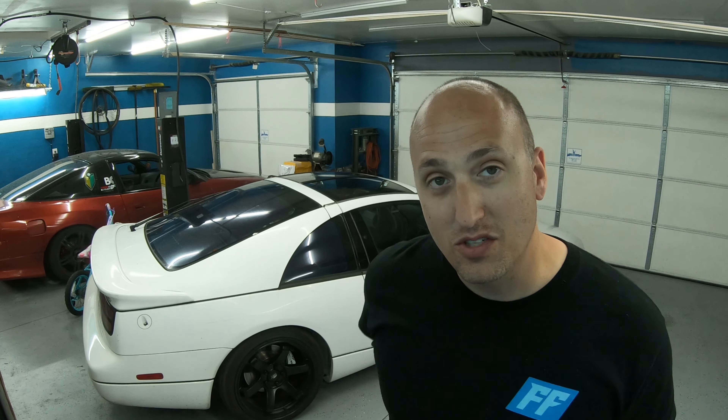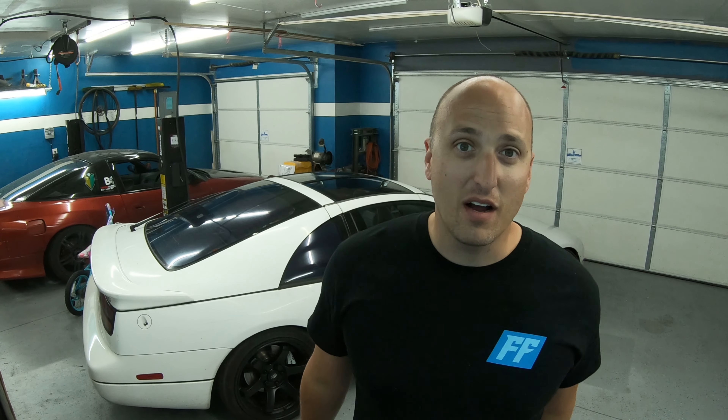All this stuff isn't free — it costs a lot of money, and we want to maximize our horsepower and get the biggest bang for our buck. We need to reprogram our ECU. The custom way is to get some dyno time with somebody who knows tuning and knows the 300ZX ECU — they're out there, do your research, find a reputable shop in your area, get it on the dyno and programmed custom for your car. If that's not an option, if we just don't have a tuner around, we can definitely go with an off-the-shelf tune.